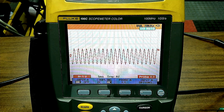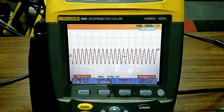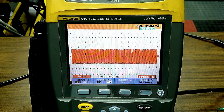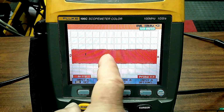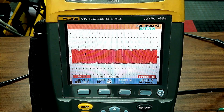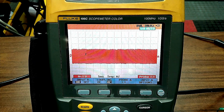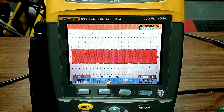If we have a problem with a crank sensor, or cam sensor, or any AC voltage, which is quite common, when you stare at the screen, because there are millions of samples a second, you may not notice any problem here. But if I actually change the frequency, you see this here? If I see a white space hole, and you should see one every once in a while coming across, I'll try to hit hold on it when I see it myself.